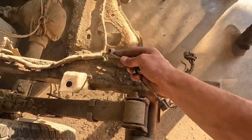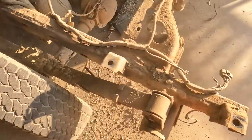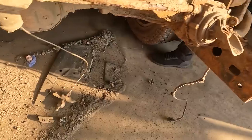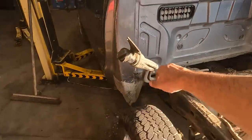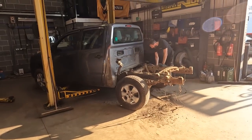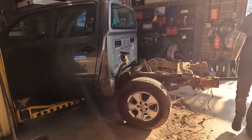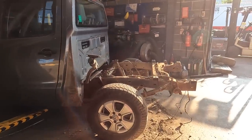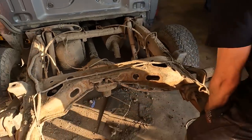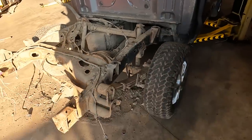There are literally six bolts that hold the tub on, plus two bolts either side of the chassis leg holding the bumper and tow bar on — pretty straightforward. We also had to disconnect some electrics, but other than that it was simple. The truck looks worse without the tub right now, but if you wanted to know what an Amarok looks like with the tub off, that's it — pretty easy. It's a simple ladder frame design.